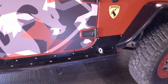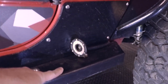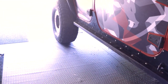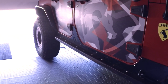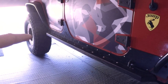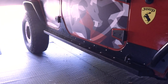This next Cyclone is bolted to my rock slider, facing rearwards, and I use these for reversing. I have them tied into my reverse switch, so when I put my Jeep into reverse it illuminates behind me and really illuminates the rear tire and the space behind the Jeep. I like these here because when I'm reversing either on the road or in a parking lot I can see really well where my rear tire and fender are, and on the trail I have really good visibility to exactly where my tire and fender are.